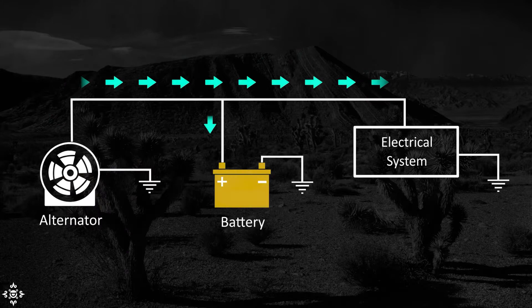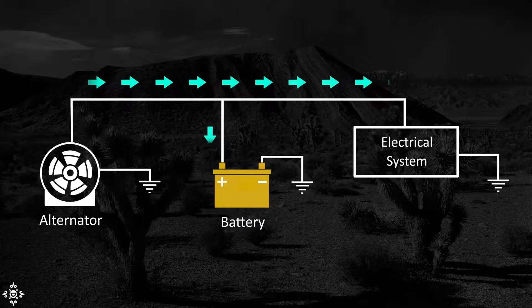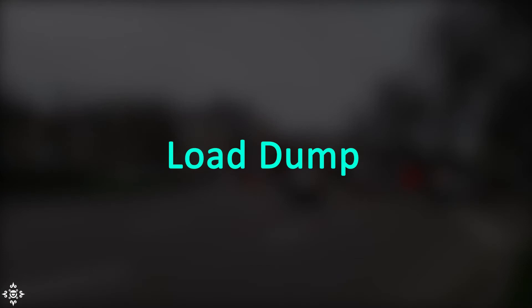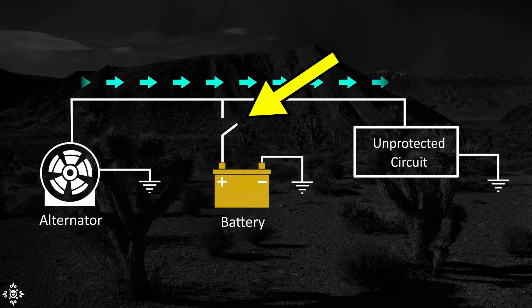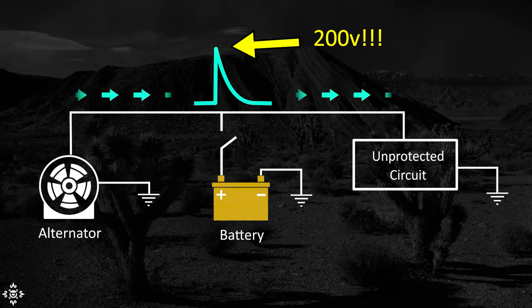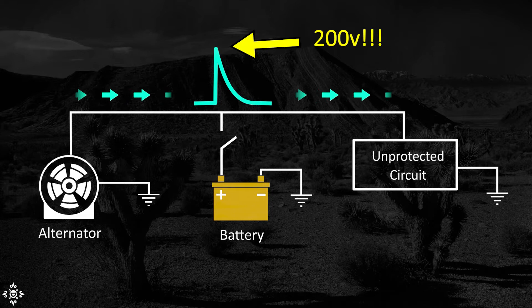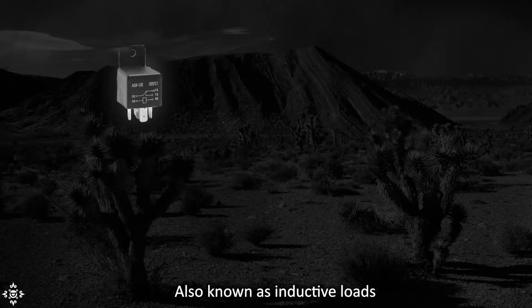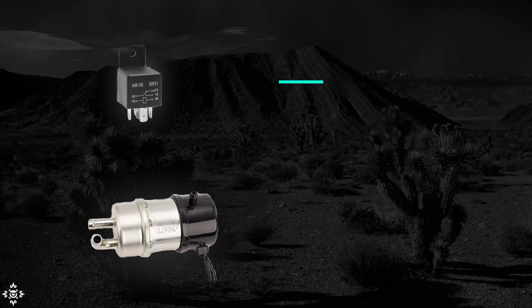Let's analyze this scenario: when we first turn the switch on in a motorcycle, the battery is the one that supplies power to the whole electrical system at first. However, as soon as we turn over the engine, the alternator takes over, which also charges the battery — the same can be said for cars. One would think this is a smooth transition, but it's not always like that. Even though motorcycles already have a rectifier and regulator, the voltage output is not stable. In the automotive world, there is an undesirable effect known as Load Dump. This occurs when the battery is disconnected while the alternator is charging it — what happens next is that for a short period of time, the alternator can suddenly supply up to 200 volts to the power rail. Any component that has a coil in it — be that a simple relay or the motor from the fuel pump — can also cause disruptions by transmitting voltage spikes along the electronic system.